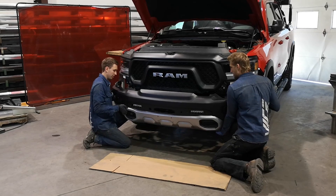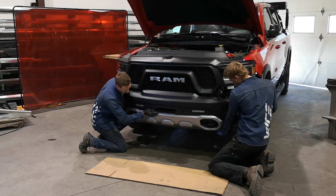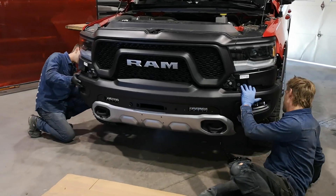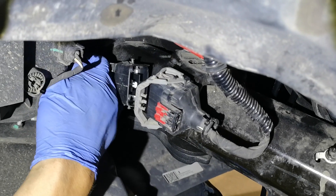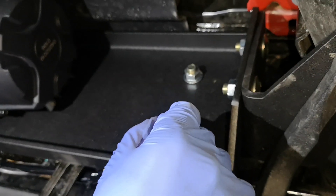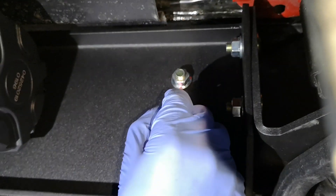Home stretch — bumper goes back on. It's definitely a two-person job: each person grabs a wing of the bumper and slides it on, adjusting the hardware up and down to line up with the holes. Once it slides in and locks, apply pressure and reach behind with the factory hardware to thread it onto the studs. Reconnect the factory harness on the driver's side frame rail in the reverse of how you detached it. Torque all bumper hardware to 85 foot-pounds, as well as the four M12 carriage bolts holding the fairlead mount.